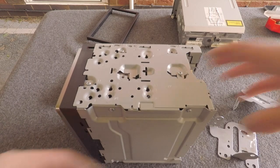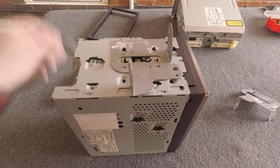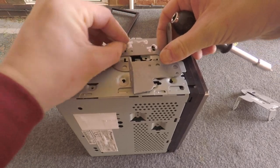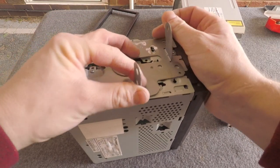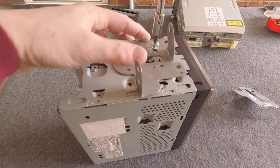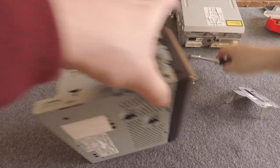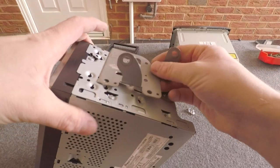Now looking at the left-hand side of the head unit — we've made those holes just a little bit longer so it can sit lower. Get the bolts in. You can see how much lower the bracket now sits across the top of the head unit compared to when we first started, before any cutting or hole elongating. Flip over to the right side and do the same.